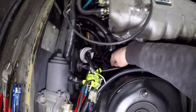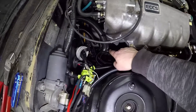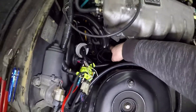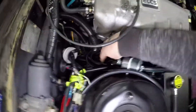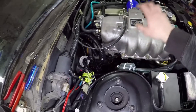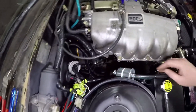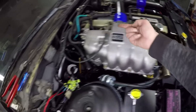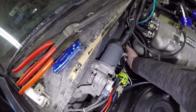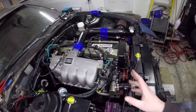I've made up the battery cable - the positive coming from my terminal, covered in loom, going to the starter motor. The lead to actually activate the starter solenoid I've extended from about this point so it could come all the way down to the end. That connector and wire is actually off the old harness from the RB, so that connector snaps into place and holds on, and the extra length of wire allowed me to drape it around there nicely. The ground for the ECU connections I've put here - it drapes all the way through the intake manifold and down to the same spot on the bell housing, just to ensure I have a really good ground for the ECU connection.